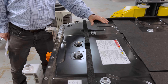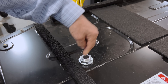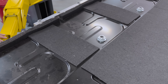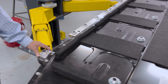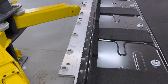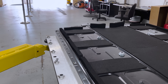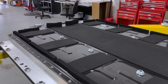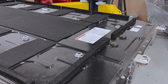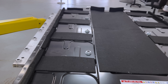You always have a combination of those two types of vents in these batteries. The smaller ones don't flow enough to release the pressure of a catastrophic event, but the larger ones would — and by the looks of them, that's probably what they do. You can see some of the configuration of the mounting: there are through holes that go right through the center of the pack for fasteners that hold the battery to the chassis, as well as outside perimeter mounting points.